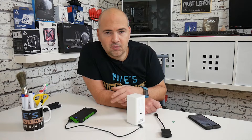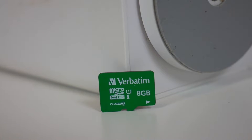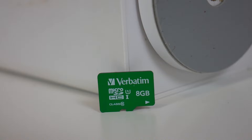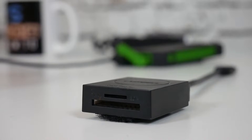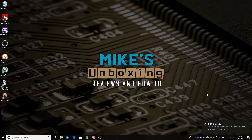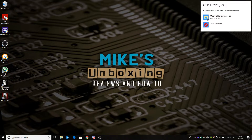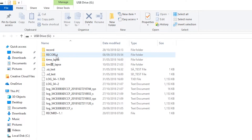I thought maybe the actual firmware is corrupted, or the SD card. So I took out the SD card from the camera — a Verbatim card. I've got the same cards in all three cameras, all roughly the same age, so I don't think it was a faulty card. I stuck it into the card reader using my Ugreen USB 3 card reader, and Windows Explorer immediately found a problem with the card. When I opened up the directory, there were a lot of weird-looking letters and digits on the folders — it looks like there was some kind of corruption. So that appears to be what happened.